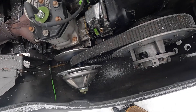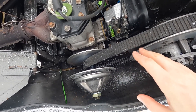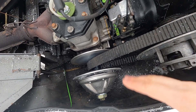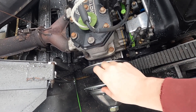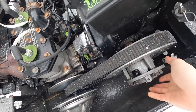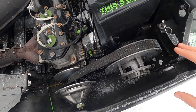I'm definitely not a clutch expert. This is a Power Block clutch - not a stock clutch. My factory clutch had hairline cracks in the aluminum casting and couldn't be salvaged, so I had a snowmobile shop install this one. They said it would outperform the stock one. You can see on the wear marks on the sheaves that the belt is getting up to about here. I don't really think it should be going much further than that, which leaves the secondary clutch as a question mark. I'm going to rev it a little and see if it looks funky.